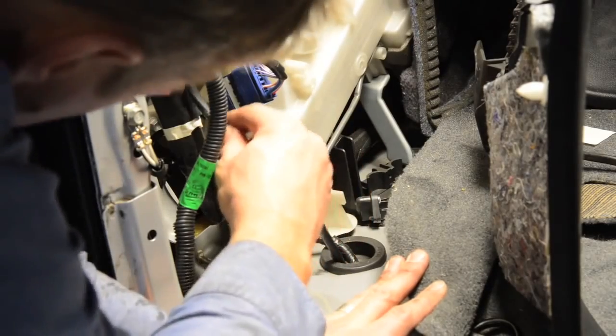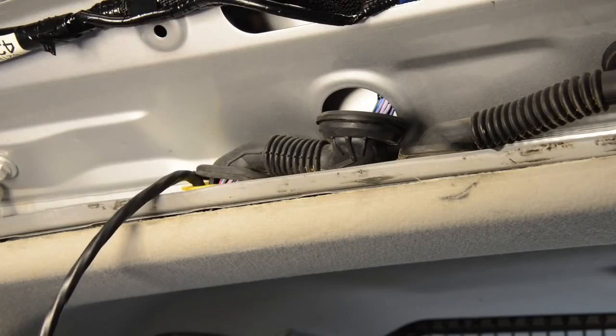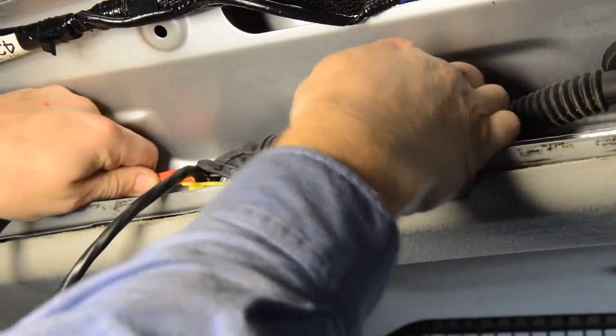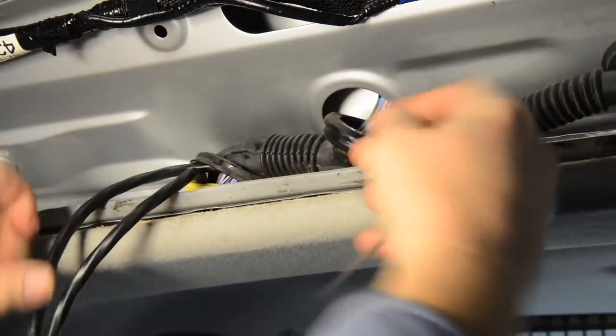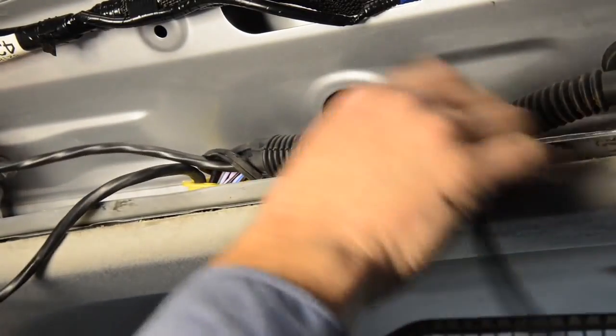Continue pulling the cable up the inside of the D-pillar trim and across to the factory rubber wiring duct that goes into the upper tailgate. Pull the cable through the duct and into the tailgate. Taping the cable to some rigid wire and using a bit of detergent will make the job easier. You can then run the cable alongside the factory loom until you reach the camera plug at the bottom of the tailgate.